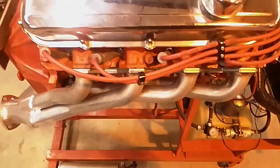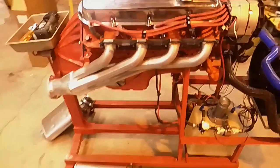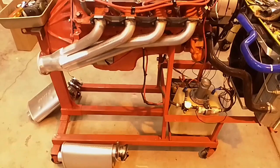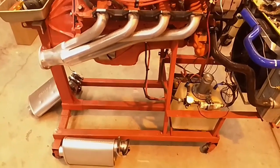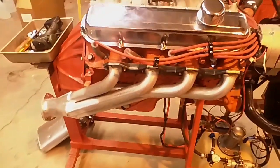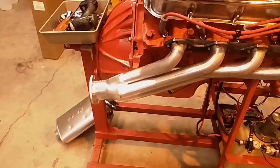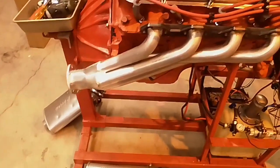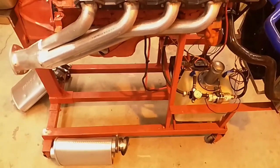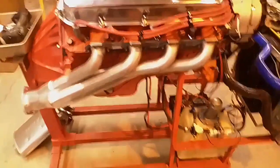They try real hard to keep it tucked in. On the truck, when I measured the frame rail in about the middle of where the motor is going to be, it was like 24 and a half inches. I marked this one on the floor, and across the motor on the outside edge of the header in the center — it kicks out a little more coming back, but there's actually more room on the frame back there. Right here in the middle, this one is coming out 27 inches, so this is pretty darn close.